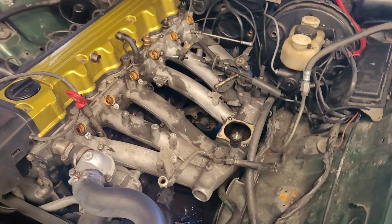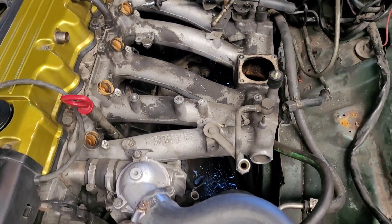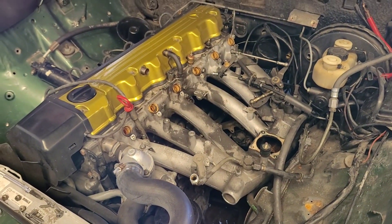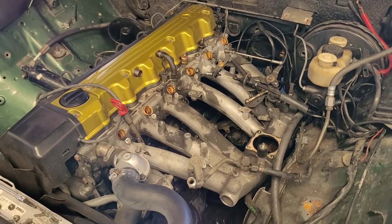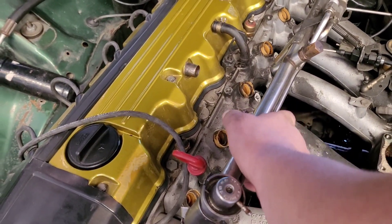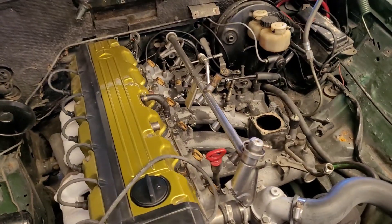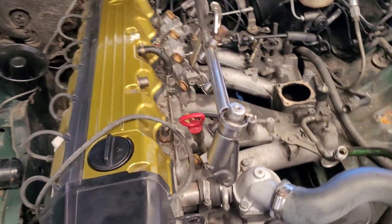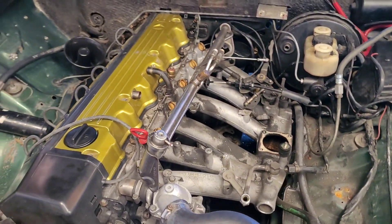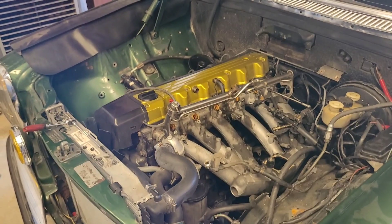Everything is officially off that needs to be taken. The throttle linkage is going to be staying as-is. We will be cleaning this entire intake manifold as well as the throttle body because it is extremely gunky, but other than that it's that easy to remove. We're going to be replacing that whole CIS distributor with this right here — an M104 fuel rail, which is basically the dual overhead cam version of this engine. This does get cut and modified. I'll show you how to cut and modify the fuel rail, the throttle body to fit the throttle position sensor, and how to make the throttle body spacer. That's going to be it for this video — thanks so much for watching, see you in the next one.